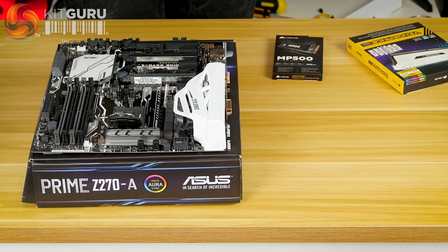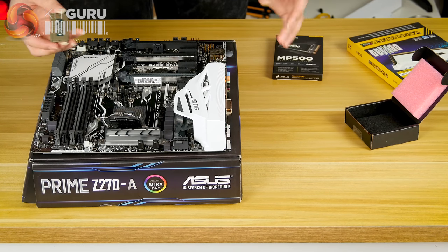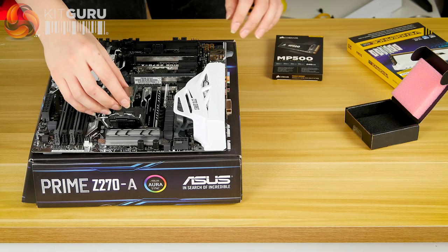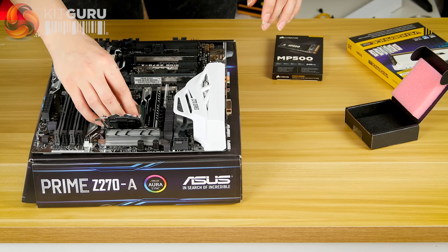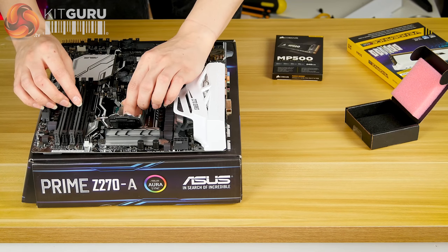And that's probably the most important thing to check. Apart from that, it's just sort of be careful. Pick it up carefully. I always find this bit is probably the scariest. This playing around the motherboard, like putting the RAM and putting the CPU in, is probably the scariest for me. Don't drop it, don't push it, just sort of gently place it into its little slot.